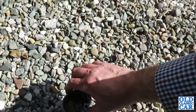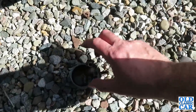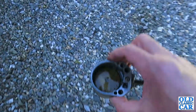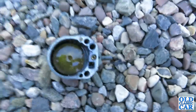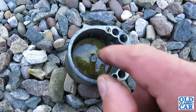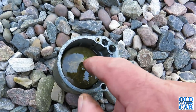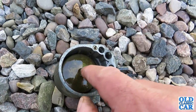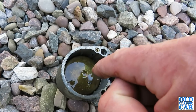There's a float inside the brass. Now the problem is this float is no longer a float. There's petrol in here and this float should be floating on top of it, but it's not — it's sat at the bottom. What I think has happened is the float has developed a leak and it's probably filled with petrol, so it's no longer floating up and switching off the needle valve.